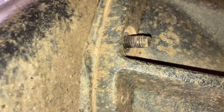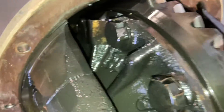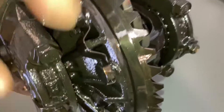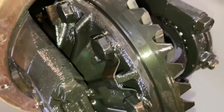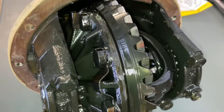You can use RTV, but I'll just use genuine parts — goes on clean and dry. Is that the last one? Beautiful. We'll lift it out. There it is — it's out. You can see how the paper gasket breaks there; that's why you need to replace it. Get a razor blade, clean that off and it'll come up nice and clean. What we're going to do in here is replace this whole center section. We're just going to reuse the crown wheel — some people call it a ring gear, but that's confusing; to me that's what's on a drive plate. We'll go through more of the components in another video. This was mainly about getting it out.